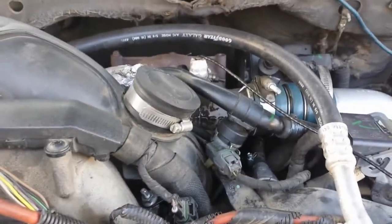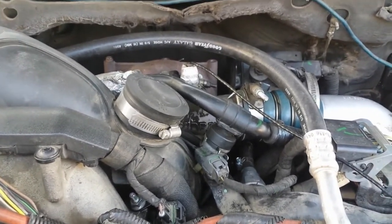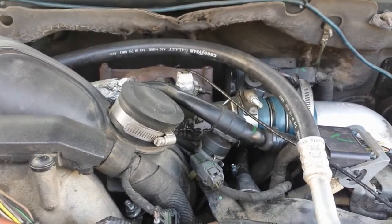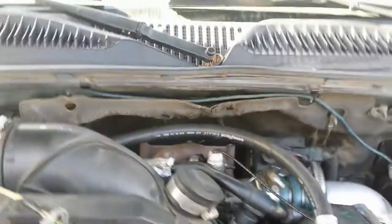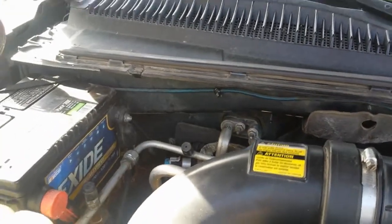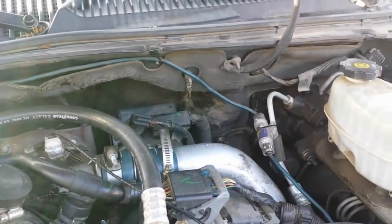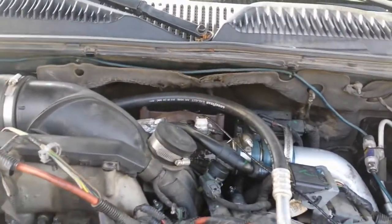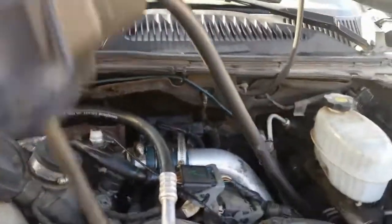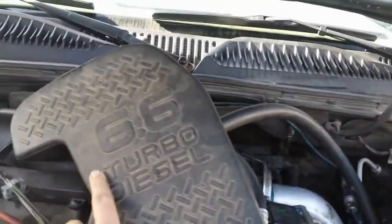The problem is you're going to have oil going through those lines, so it's going to leave a drip, and I don't want drip marks on my driveway. So what I'm doing is a catch can. I thought about getting a catch can kit but I'm not sure where I'd put it — honestly there's not a whole lot of room. So what I've decided to do is modify the resonator since I'm not using it anyway.